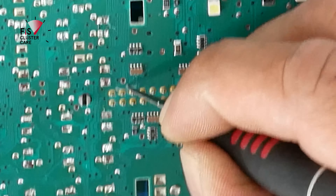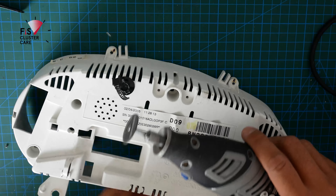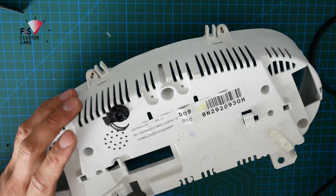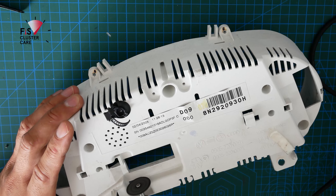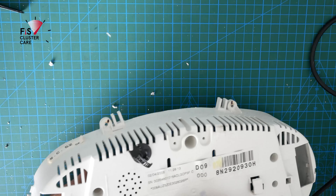Here's a close-up of the cut traces — quite simple to do but you have to be careful. In the next step we need to prepare the rear housing by cutting a little notch in the marked area for the ColorMFA USB plug to stick out from. I'm using a Dremel tool here — it's a bit fiddly because it's a recessed area. The hole I've made is quite big; it doesn't need to be this large and could probably be only half that size.